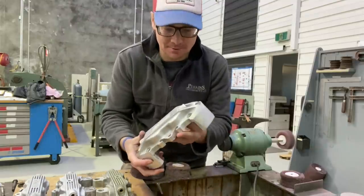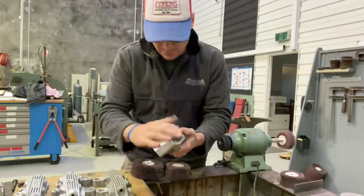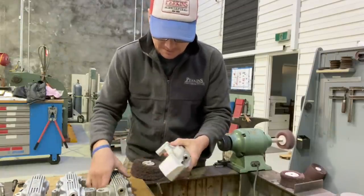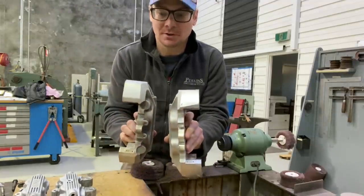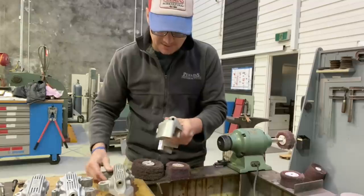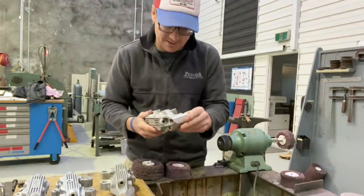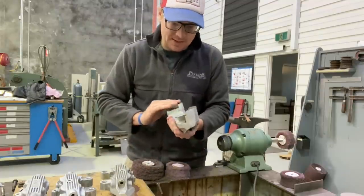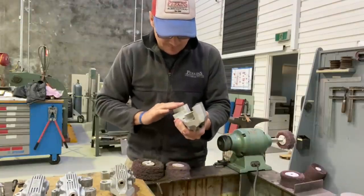After a bit of work on the mop, the product just gets a nice detail overall. There's quite a difference in the finish compared to just stripping the anodizing — it gets a lot of the shine back and takes a little bit of the rough facing off from the de-anodization process. We'll do that to all of them and then start to do a bit more detail work with some flat surfacing.